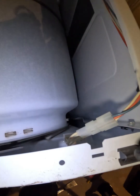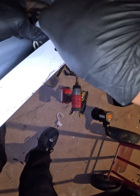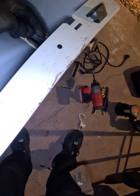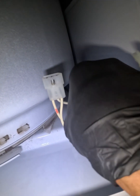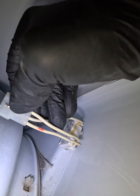I'll show you how to change the switch and also how to bypass it temporarily so you can dry your clothes. Make sure the machine is unplugged. Now on this switch, the center wire is usually the light. Your main concern is the two wires on the ends.